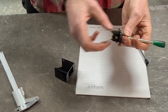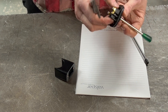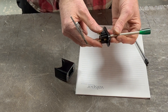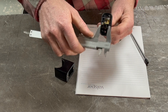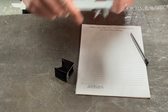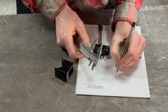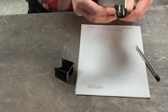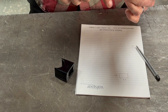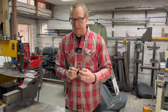I'm going to take some measurements with my vernier to start designing a little housing, which I'll probably CNC plasma cut — that's the facility we have in-house and it's certainly a lot more cost-effective than having something milled out of a block of aluminium. The first step is just to measure: that's 20 by 27. So I'll draw the cutout I want in the face plate — 20 by 27 — and the fascia here is about 55 to 56mm. That's the fundamental measurement: the section of the switch that needs to go through the face plate of my housing.